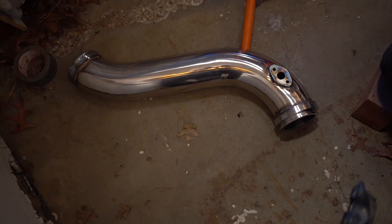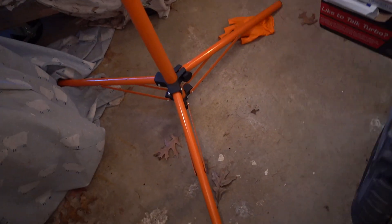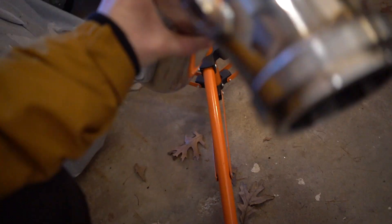I also got the four inch exhaust going on, and I'm gonna have to modify that — probably bring it to a welder and have them fabricate some stuff to make it all fit. The downpipe is a straight downpipe — it's not angled. It's not designed for a turbo manifold that puts the turbo on an angle.